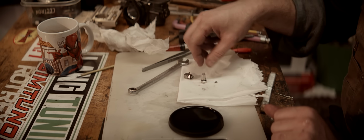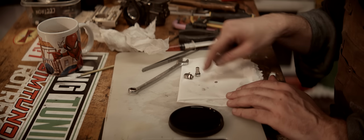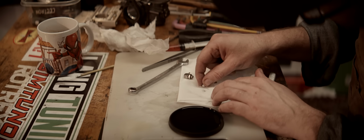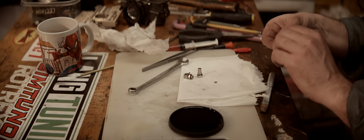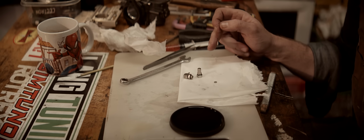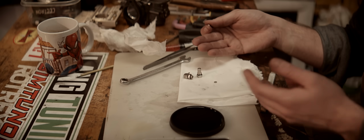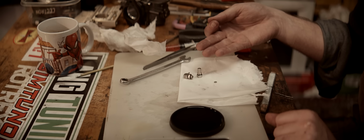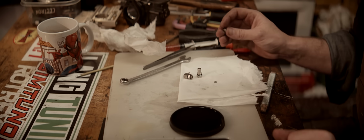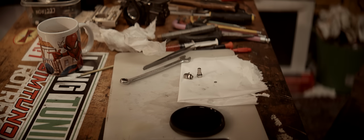I reassembled this and tried running it, and it did work, but it did spray wonky, and I pulled it apart again, and now there's metal shavings stuck in the injector. There's some steel in here, and I have a suspicion the pump is eating itself and it's not nitromethane compatible for some strange reason. I thought nitro would be less corrosive than methanol. Maybe it's just running super dry as there's not much oil. There's like 5% oil in there, versus earlier we ran 10%. Either way, this does not work how I was hoping it to work.